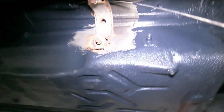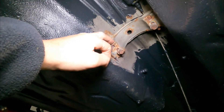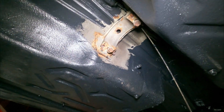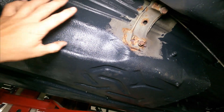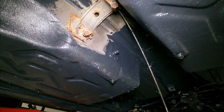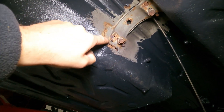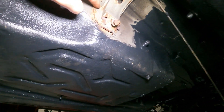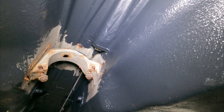Back to the hook where the bearing is connected — I'm going to remove it. In the original way it should go a little bit forward, but it's not possible because the muffler is in there. So it will be moved a little bit, only like 5 centimeters, but that's the case. I'm going to hammer it off, hammer all the welds off, because I cannot drill out the welds. If I have these side plates, I can just clean them off and weld them back onto the body — that's the best.